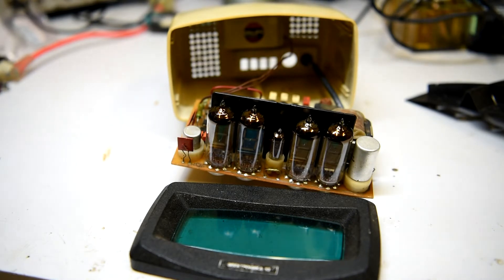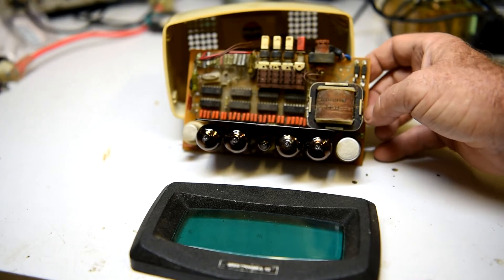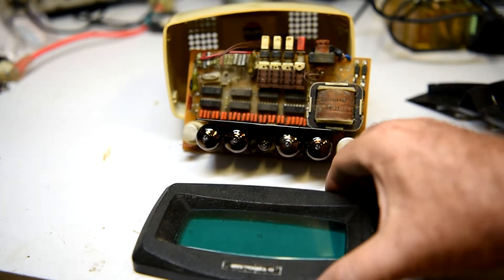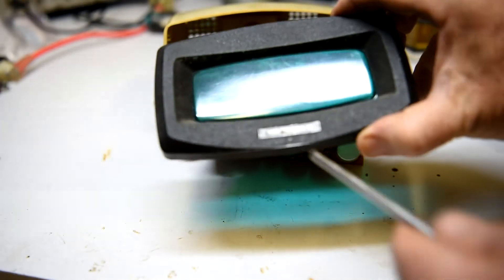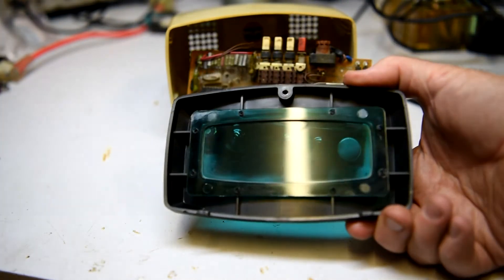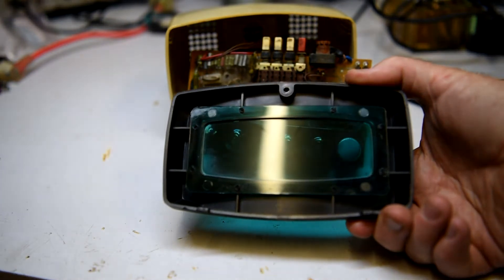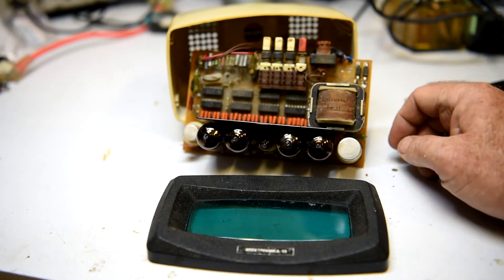You can see the lineup here — the board is pulled out once you remove the front cover with a filter. There's a screw point at the bottom of the cover which is hidden, so undo that screw, then the cover is pulled away and the main board can be withdrawn.